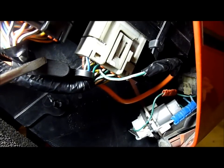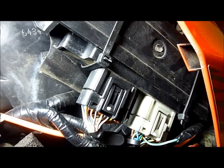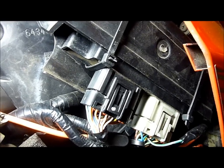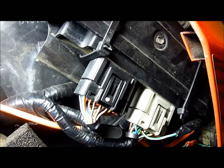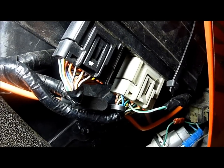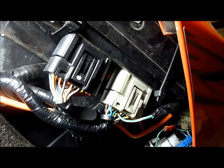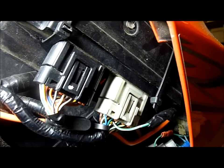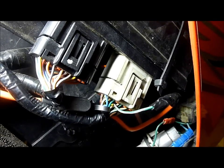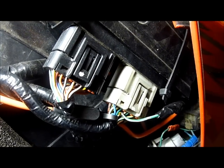However, in the meantime, I have a switched circuit and I've just put a fuse in there just in case I have some electrical issues. But yes, you can swap an American ECU into a Euro or Aussie bike. I've only tested this on a VFR, but I dare say it will probably work on any Honda bike with PGM-FI that has similar hardware — in this case, CBR1000s and CBR600s. All the ECU hardware is quite similar within the same year ranges.